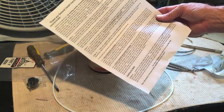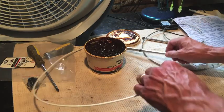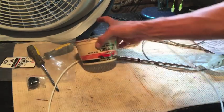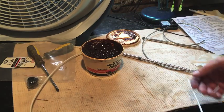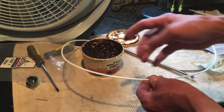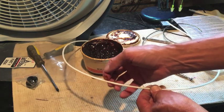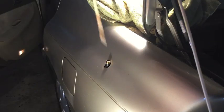When in doubt, read the directions. Going by the directions, when I took the cover off the motor they recommend putting wheel bearing grease - any kind of wheel bearing grease - into that little ring. I'm not going to take the motor back out to do that, but I am going to put some wheel bearing grease directly on the shaft, which should accomplish the same thing. Just put a little bit all the way along the shaft.